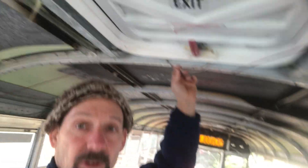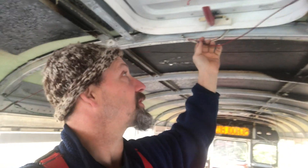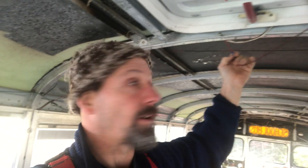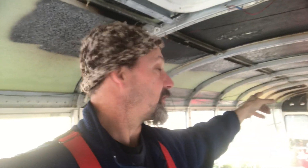So we've checked the emergency exit doors, both back and the side. Now we've got to see if we can do the roof hatches, and we've got to check the windows too. From what I understand, if it's only one wire going up to the exit hatches, you can just unclip them. But I'm going to do the same process — I'm going to cut this right at the crimp, then make sure the bus can start, and go back to do the back one as well.